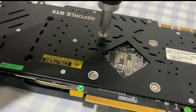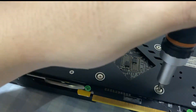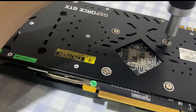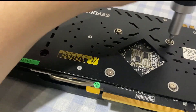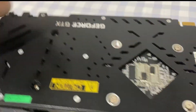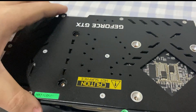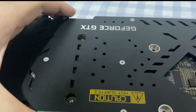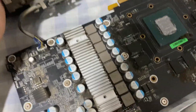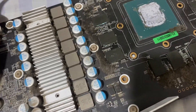It's going to take a while. I sorted them in one spot so I don't get confused by them. It comes right off. In this card I didn't need to unscrew the back plate since it allowed me to remove the GPU cooler without doing that, but in some GPUs you can't access the GPU screws without removing the back plate first.